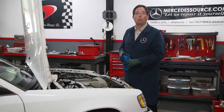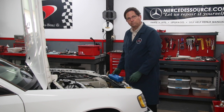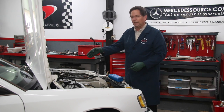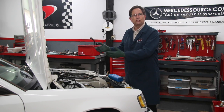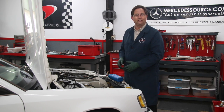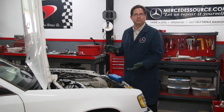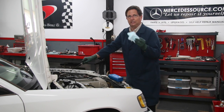You just saw me checking my transmission fluid with the engine not running — just a couple of tips on that. When checking the level of transmission fluid in your automatic, you have to have the engine running and the transmission in park, but you need to have driven the car at least 15 to 20 minutes so the fluid is up to full operating temperature. Then you can pull the dipstick, wipe it, and read the level.